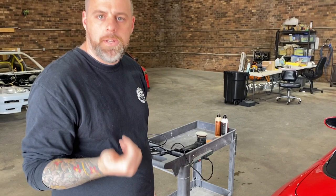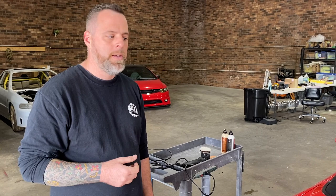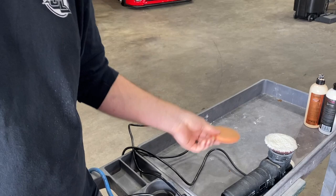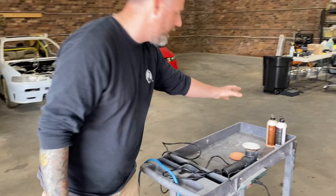The last time I did your window, we used a dedicated plastic polish. This time around, I'm going to test a compound polish that you would use for your paint. I've done this before and it seems to work okay. So most people who tinker or DIY are going to have these kind of things laying around. The only thing they might not have is a machine, and that's really going to speed up the process and make it look a little bit better. So if you have it, use it. And that's also the reason why we taped it off. You can do it by hand, but just don't expect the same results as far as clarity. So just a little random orbital polisher - this is a three inch polisher. I'm going to be using a Meguiar's microfiber and then a Lake Country orange pad as the final polish. That's my go-to for most things universally. And we're going to be using a compound and a polish in a two-step process.